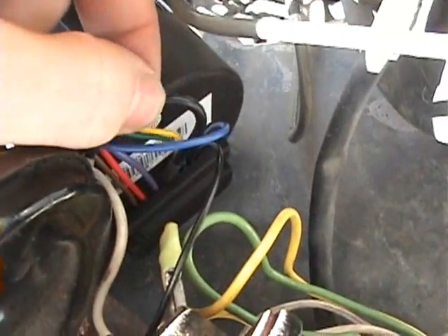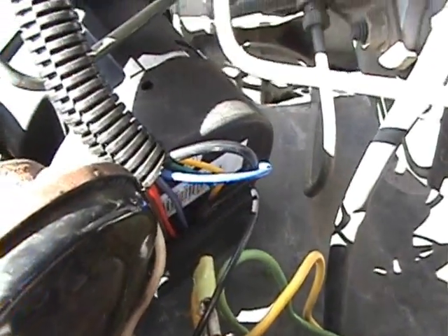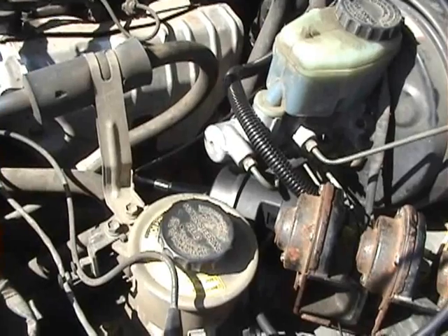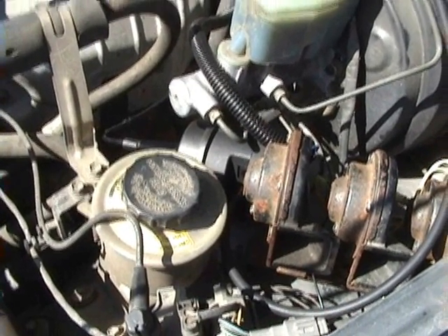Also, they give you the VSS flyer, which I think is the gray one. It's wrapped in this black one — the gray and black one for the magnet kit and VSS. Don't use the VSS. There is a panel over on the other side. I tried that and it blew the brake light fuse, so it didn't work. Don't do it. Just go by the TAC only.